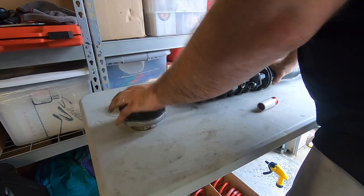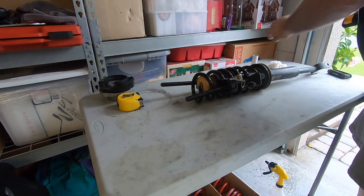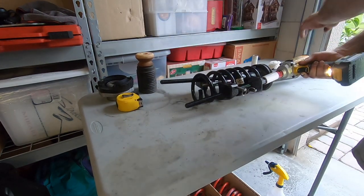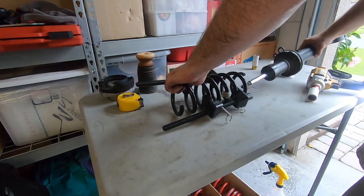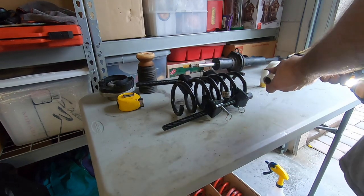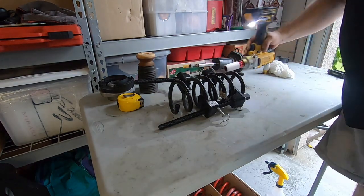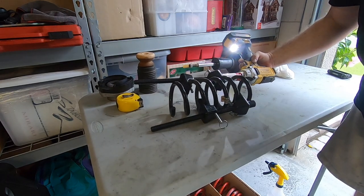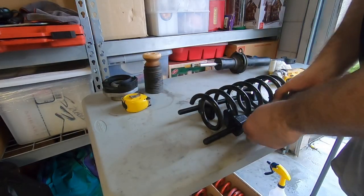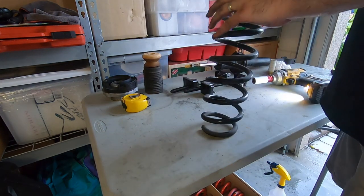There we go. Go ahead and pull the top off, and then slowly — and I do mean slowly and evenly — undo the spring compression. Pull that boot out and then pull the spring out. Now slowly release. Go real slow, don't have your hands near it because if it springs it's going to be a bad thing. Finally got these off — pull that aside, remove the safety pins, and there is the factory spring.